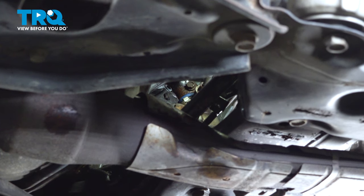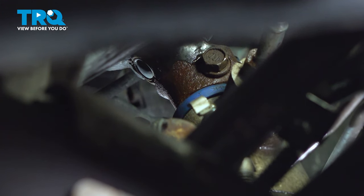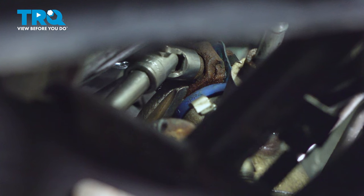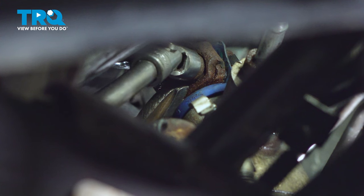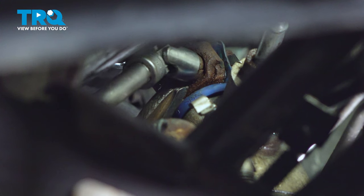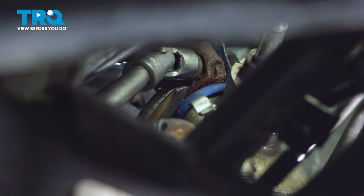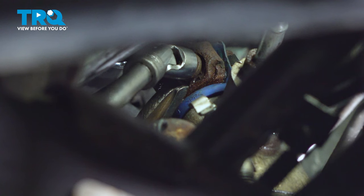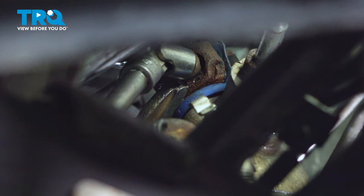Now, before you take the tie rod ends out, I recommend breaking this free, and then we'll move on from there. So I took a pair of locking pliers and locked it on the base of that steering joint, because even though the steering wheel's been centered, the tie rods are still in, and because it has an electronic device to the rack, that solenoid will allow that steering column to spin while you try to loosen this pinch bolt. So by putting that locking pair of pliers there, I can get a swivel socket in there and take this pinch bolt right out. Because even if I put the seatbelt on the steering wheel, it still would have had too much give and spun. Because even a half inch up there is like a foot down here. And this just made it less complicated.